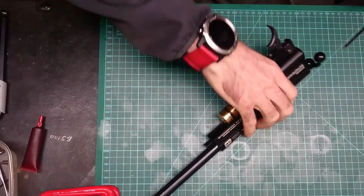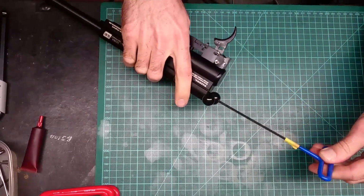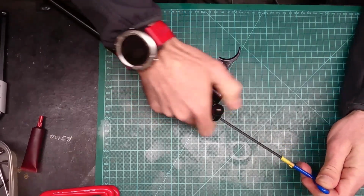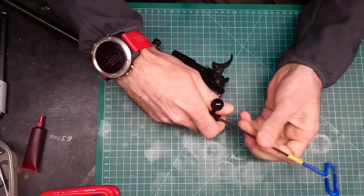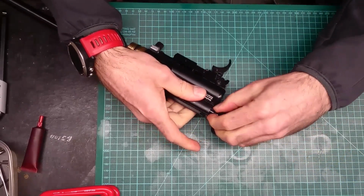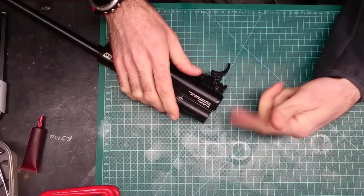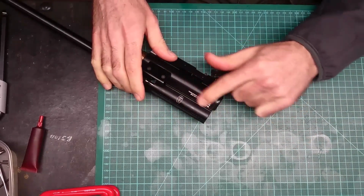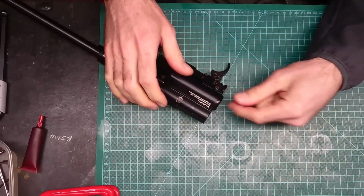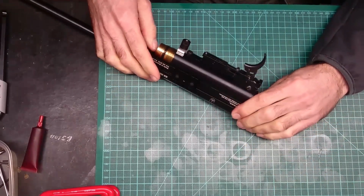There's no right place to start or wrong place to start, but basically I'm going to start with the bolt. You see, if I turn that, the bolt moves as well, so it's always a good idea just to keep a finger on it or your hand and then crack that off. These normally have some Loctite on them from the factory, so they can sometimes be quite tight, and if you don't hold it, you can obviously damage the bolt on the inside, the probe, so make sure you support the head of that to stop it from damaging the insides.